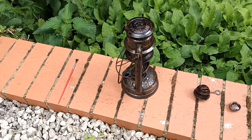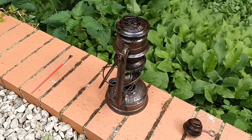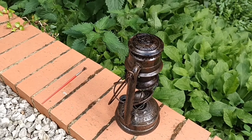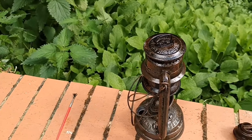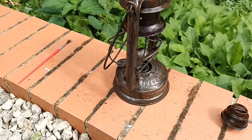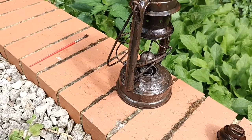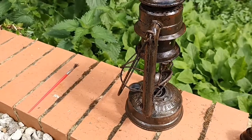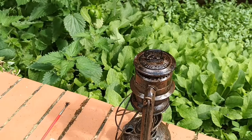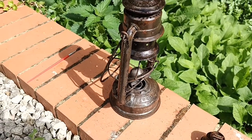I was gentle to start with and then got a bit vicious with it — shook it like a billy can, every angle, to coat it all up. I did it gentle, I did it harsh, everywhere I could think of. As I was waiting for it to go off I super glued it — I started super gluing just to fix the outside of the tank. There were so many leaks everywhere I super glued all the little holes so I could then fix the inside. It was never going to be pristine, I just want it working and functional — and I think that tank is never going to leak.